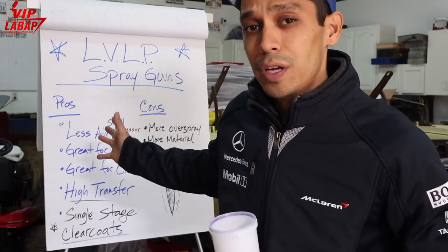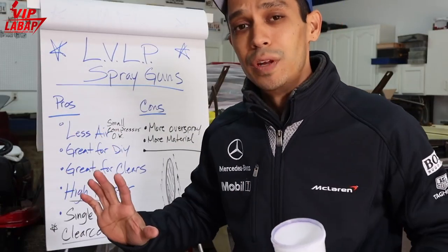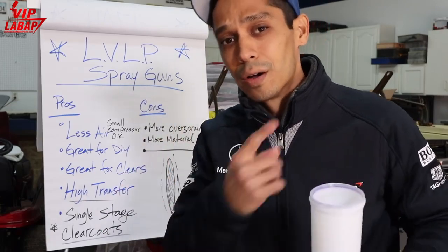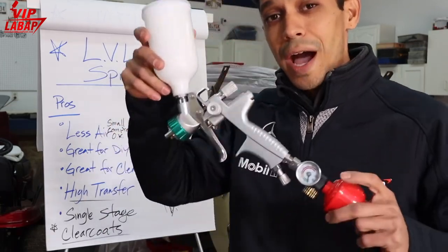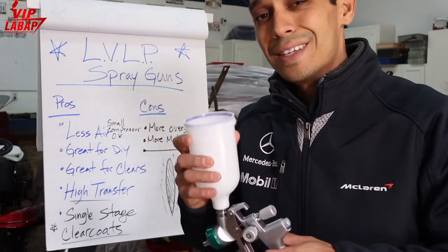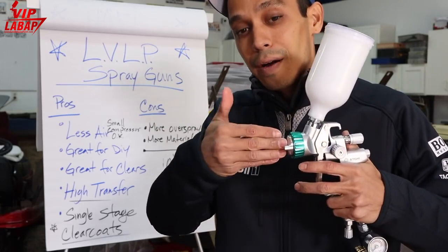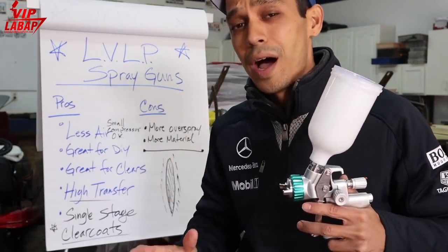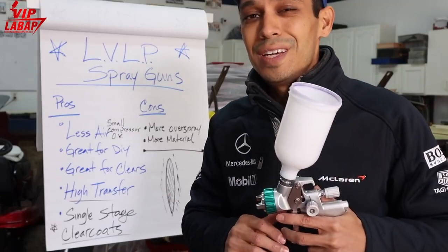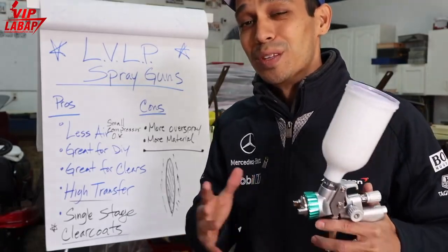You can see some of the videos on my channel and at the website; I have tons more videos on this, so if you want to check that out, click over here to learn more. But anyway, the low volume, low pressure Atom X27 here also has a very good transfer rate, so you're going to get a lot of material coming out. It has a little bit more overspray than the high volume, low pressure, but really not a huge difference. You're really not going to notice it that much between the two guns.